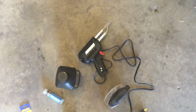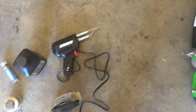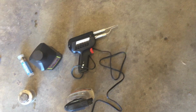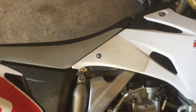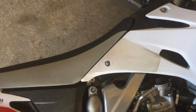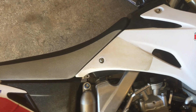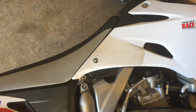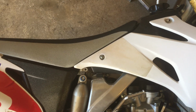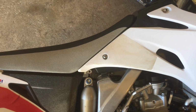100 to 1. But like I said, filled that hole up with my penetrating oil and then used that soldering iron to heat that bolt up and heat cycle it about 3 times. You want to be careful too. We're not talking about anything extreme here. You don't want to get that thing glowing red or it'll melt through your tank. But just a light heat cycle just to help break up that corrosion and help the penetrating oil go in.